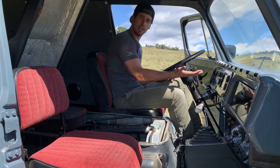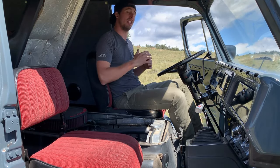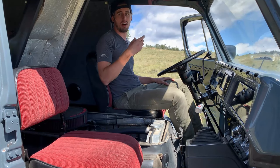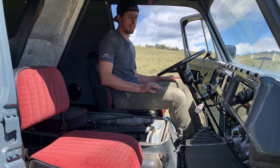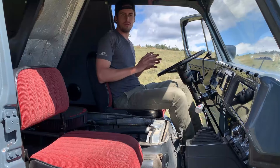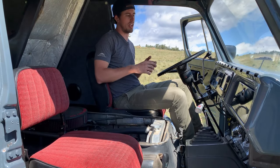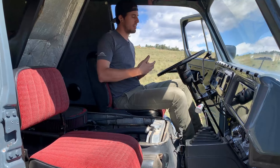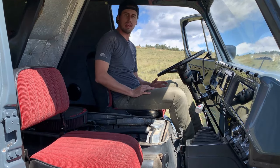The van has the old 3-speed shifter — I generally just put it up here and click it out of the way. I'd love to make that a 4-wheel drive shifter at some point. I currently don't actually have a 4-wheel drive shifter, so I either have to hop out and lock the hubs or hop underneath the car and move the shift rails. The shifter is a B&M ratchet-style shifter, which is the easiest setup when swapping in an automatic transmission because it's cable-driven. It's a little tricky putting parts in the van since the engine is behind you — throttle cables, shift linkage, transfer case shift linkage — because the transfer case and transmission are five feet behind me.